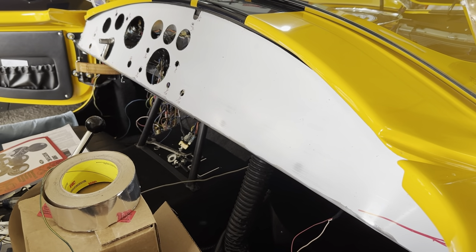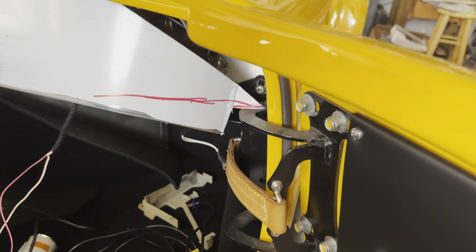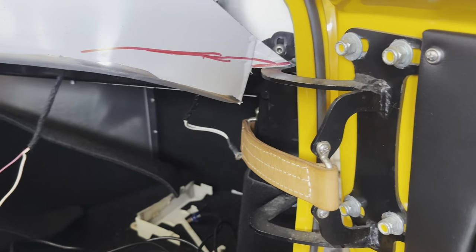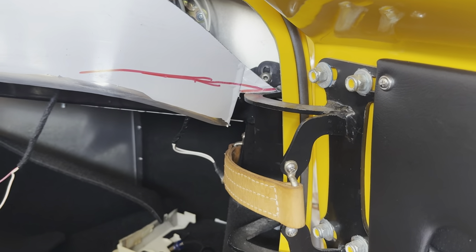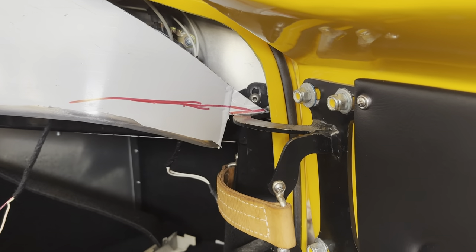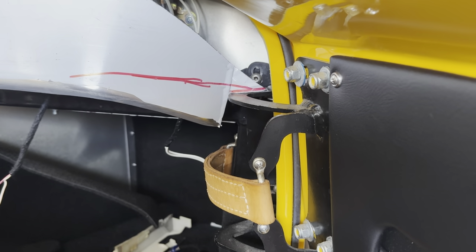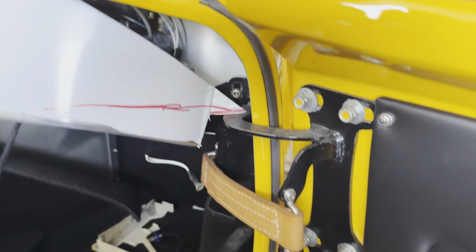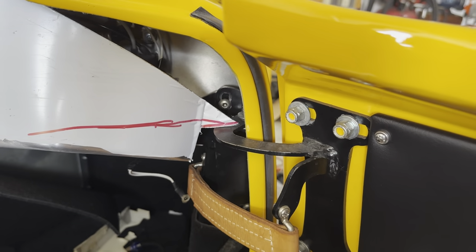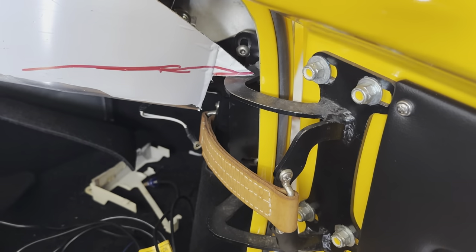So I'm going to pull it back out, take a few measurements, take a look at things, and get a better idea. First cut did equal parts each side. You can see it's just clearing under the hinge right now. It's also hanging a little low, so it will clear just fine when it's actually put up into place. I'm going to need to go in probably about another inch in clearance for the hinge, so I'll have to cut in a little bit more into that curve so when this door is closed I have full clearance of the hinge.